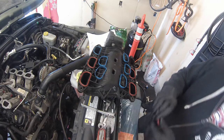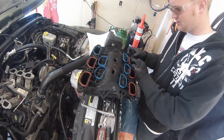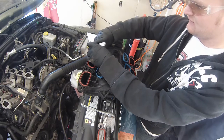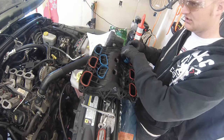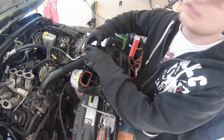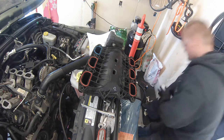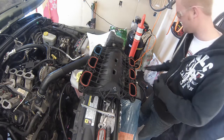And if you have an excessive amount inside there, it's pretty indicative that you had a PCV valve that went bad and you had excessive blow-by. I'm not too sure what failed first on this engine — if it was the PCV valve, which caused a lot of oil to get on the tops of the pistons, or if the piston ring seized and then caused excessive blow-by which made the PCV valve fail. I don't know what came first, but either way, replace the PCV valve, replace these — do it right so you don't have to come back and do it again.